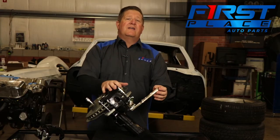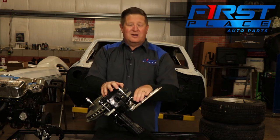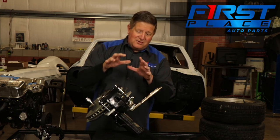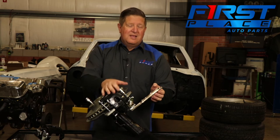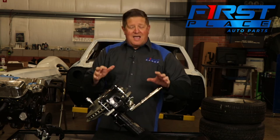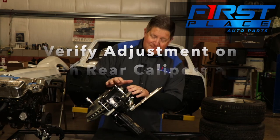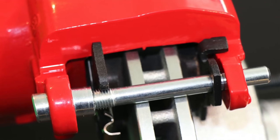It might take a few more or a few less in your application. But that's what's required: put the vice grip on the brake arm, don't take this spring off, don't take this arm off. Make sure you have everything fully loaded — brake pads, caliper, and rotor — and simply snap this thing while it's on the car. After we've done that, we want to make sure the distance and amount of tension is the same on both sides, that the piston has come out the same with equal adjustments.